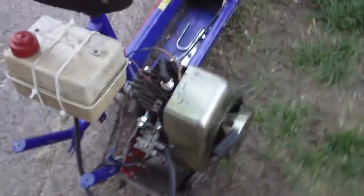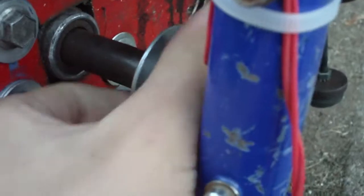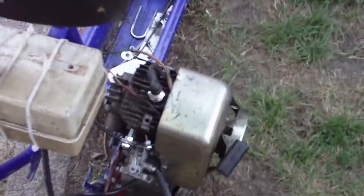That works pretty nice — little lever for my bike from Walmart. The cable engine runs nice. Like I said, it's mounted on the frame. I'm going to buy a clutch board — I need like ten more dollars and I can buy the clutch and everything for it. So it's going to be a number 35 chain drive, and I'll mount the sprocket on the wheel here, then line it up and we'll be ready to go.